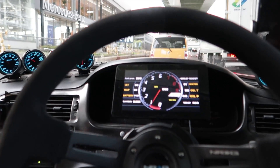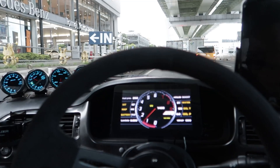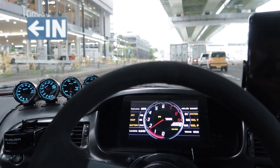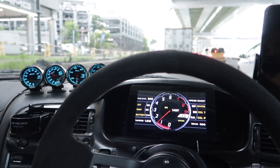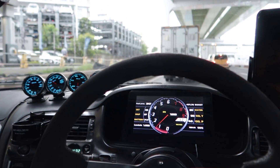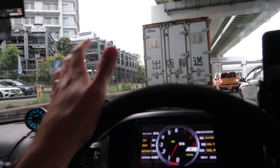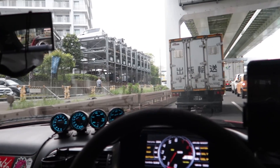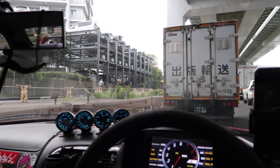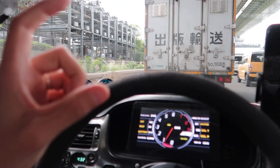It is now the next day and I've been out road testing the car. Alternator is perfect — we're not seeing any voltage dropping below 14 volts, which is perfect. It further confirms that the other alternator was just dropping voltage, overheating, and shutting off essentially. But I'm about to go to Up Garage because I've got some parts I want to get rid of — the old brake rotors and stuff — and just sell them.